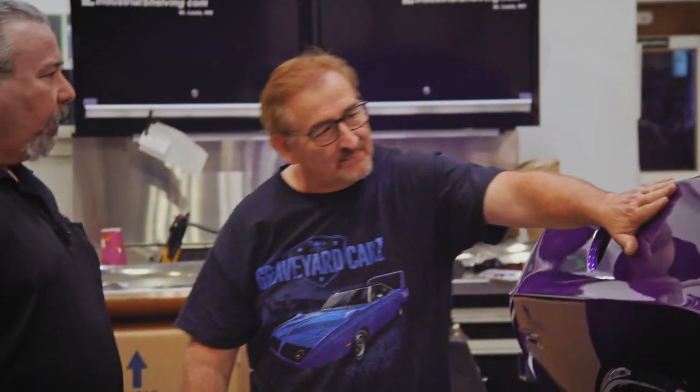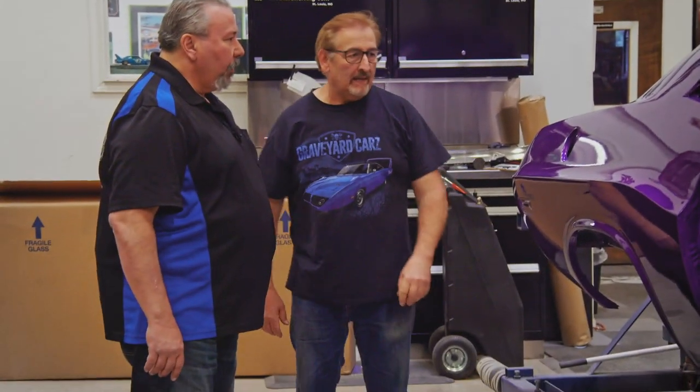I was taking a picture to show him that there was progress on the car. That's normal for a pre-paint — that's why we pre-paint it. The pre-paint will actually go into those little crosshatches. So you put this down, you long block it with 600, like a sheet of glass.